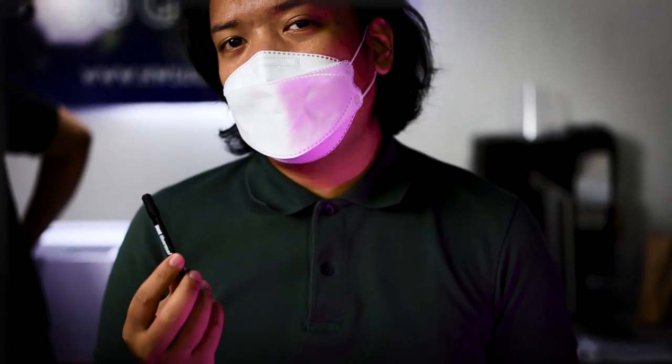And we're going to take this opportunity to warn you guys. Warning! In our last video there was some controversy, but this time I'm warning you. If you're going to use this, make sure your cooler, cooler pad, or cold plate is not aluminum. It can have other aluminum parts, but whatever touches the liquid metal should not be aluminum. That includes stock coolers, so this can't be used on stock coolers. Right, Jay? Yes, because the Intel stock coolers, the AMD Wraith, the Spire, I know those are aluminum. So don't try this on those systems.